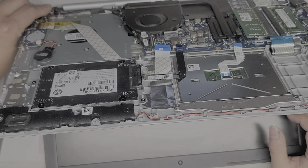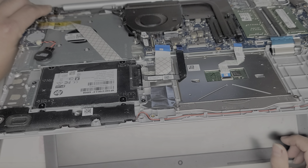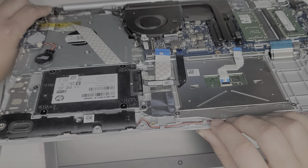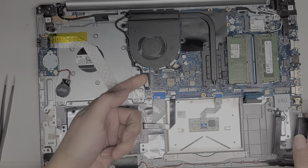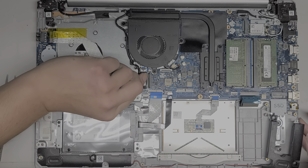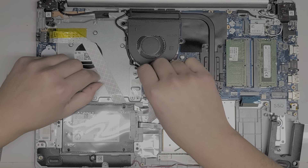Normally the safest way is to remove the battery and then press and hold the power button first. If you wanted to be extra safe, you can remove the battery and then press and hold the power button before you remove any other cables — that's mostly important just for this LCD cable. Pop up that tab and pull this one out, just like that.